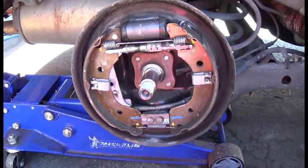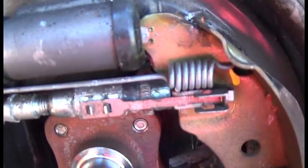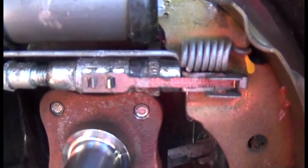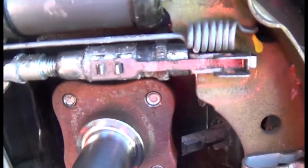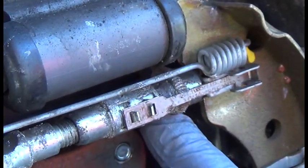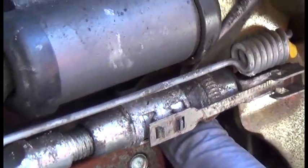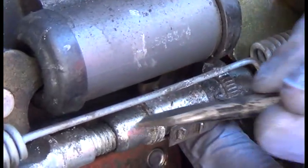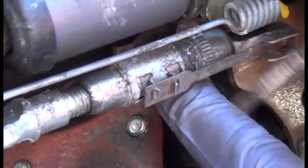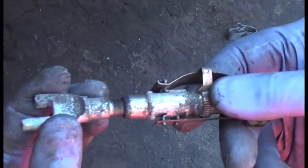The drum is off. There's your ratchet right there. I'll get a screwdriver and show you the self-adjusting ratchet — it's this thing right here. I've just checked this ratchet and it is seized as well. When you turn it, watch what happens — the entire shaft tries to rotate. It's trying to rotate but it's seized up. This shaft is inside a cylinder; the cylinder is not supposed to move, only the shaft inside it should move. So this one is seized up as well.